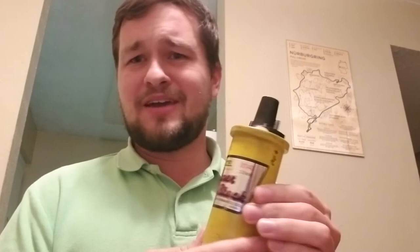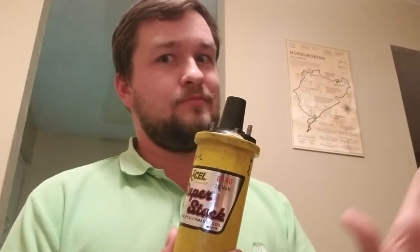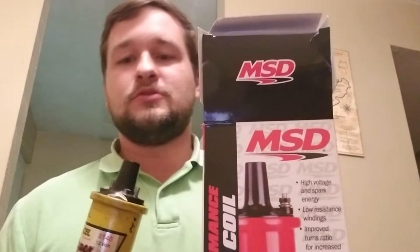That's a pretty common thing with rotaries — the coils will fail because the engine demands so much out of a coil. Most vehicles run on one coil: all your old American V8s, your V6s, four-cylinders — everything from the 80s backwards pretty much runs on one coil, except for rotaries. So do yourself a favor and spend the extra — I think these are like 60 or 70 bucks total — spend the extra 15 or 20 dollars and get the High Vibration Blaster coils.